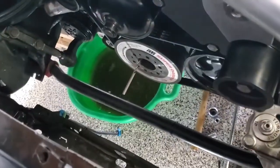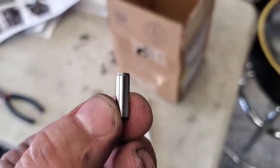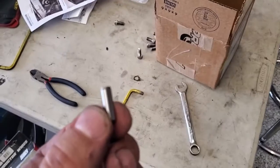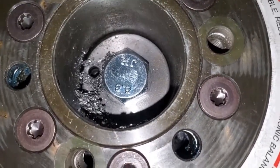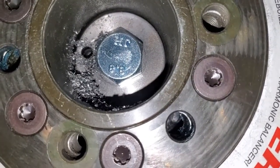We're going to drill out for this pin. You just want to drill just a tiny bit deeper than the pin itself. They say it's 0.8 inches, so we'll give that a try. I've got the hole drilled to what I believe is the right depth, so we're going to clean out the shavings and pull the jig out.